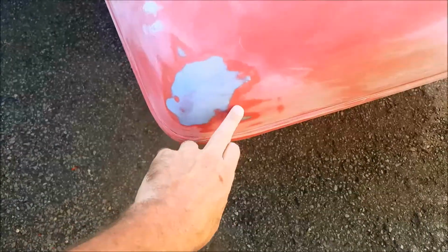Hey guys, took it out for a wash. I pretty much said I was calling it quits for the day. There was a little dealer sticker here. It was really pissing me off. Since I was scuffing all the perimeter down with Scotch Brite, I thought, oh, I'll get some lacquer thinners out and get that glue off of there with Scotch Brite. Well, yeah, I did. And it raised all the base coat up around here. So I had to let it dry, and I had to sand it back. So, word of caution. Got exposed base coat. Don't put lacquer thinners on it.